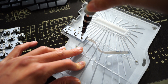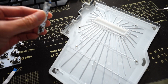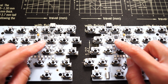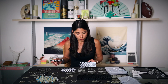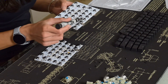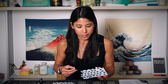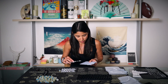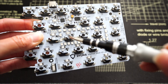The main computer on each side is this microchip, and its job is to read all the keys as quickly as it can and communicate with the LED driver, which controls all the LEDs on the keyboard. For every key we have these cool sockets — these allow you to hot-swap your mechanical switches and handle the electrical connection. We also have reverse-mounted RGB LEDs for each key, and additional LEDs for the underglow.